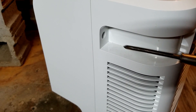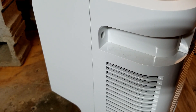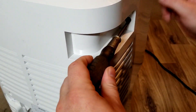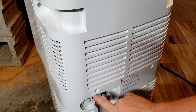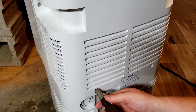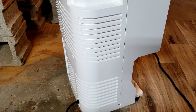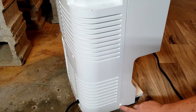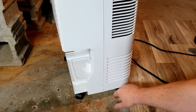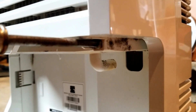Most of these have a whole bunch of screws in the back. Each model's a little bit different, so you might not have screws in the exact same location. For this model there's one here and one on the opposite side, and a couple more in there. You need a long screwdriver for these. There's one way down at the bottom, and one on the side. Normally there's a little tiny cover over that one, and those can sometimes be a pain to get out — use a little paper clip to pry it out. Usually there are screws in the front on each side too.